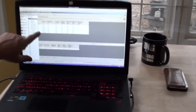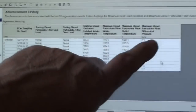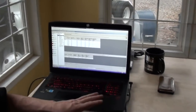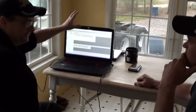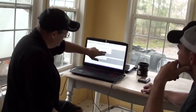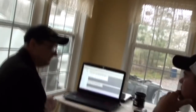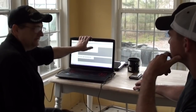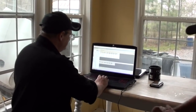You can see the hours and how often it's regenerating. What I like to look at is the INHG on the far right — it should average less than three. When it's consistently above three, it's costing you fuel, it's not healthy. This one shows 1.2, 1.7, 1.8, 0.6 — the last one is a little high since you just replaced the engine, but the regen history isn't bad overall. It may still have some life before you have to tear apart the exhaust system and clean the cans out.